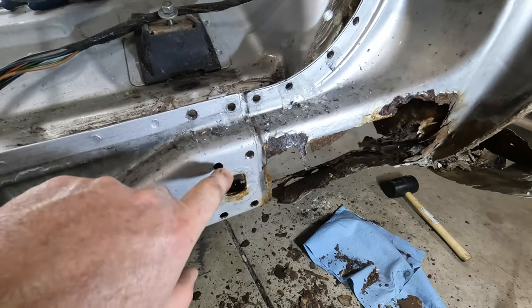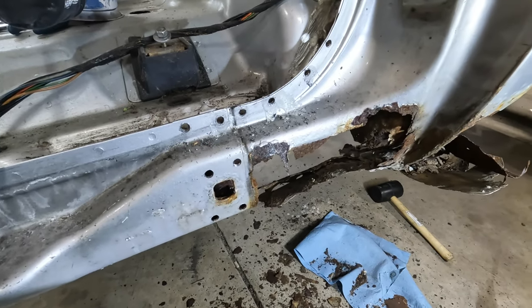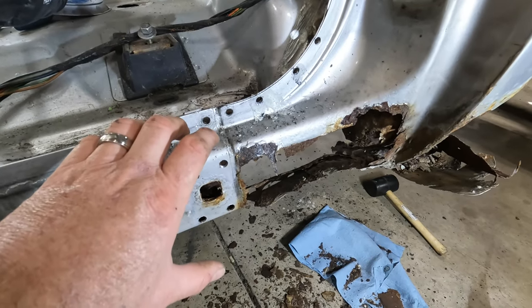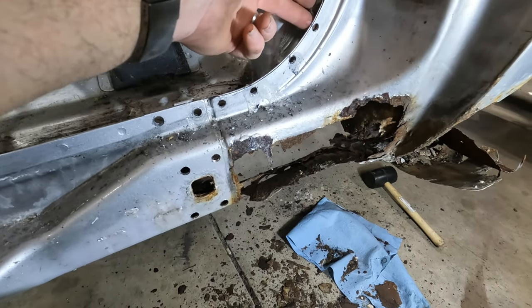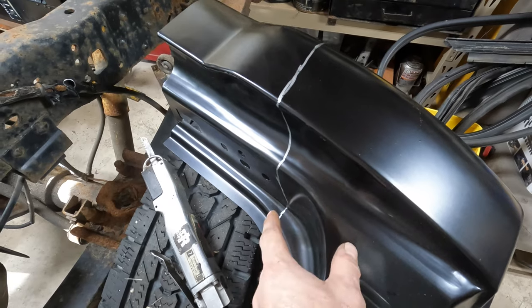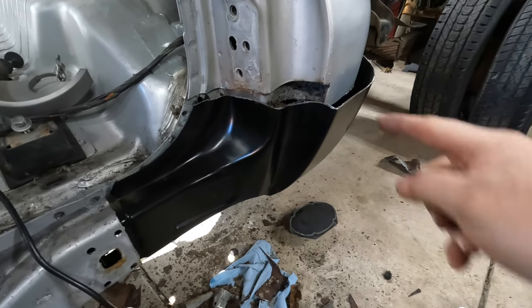I have already drilled out all the spot welds. They do make a spot weld drill bit that allows you to take out the front side of a spot weld and separate things, but in this case it's just not necessary. I used a regular drill bit and drilled all the way through, because that also allows us to take a welder and weld behind the new pieces in place — which is very acceptable. You can fill those holes back up, sand them down, and make it look really nice. I've taken a silver Sharpie and marked where I want to cut, and I'm just going to use a little body saw to make those cuts.